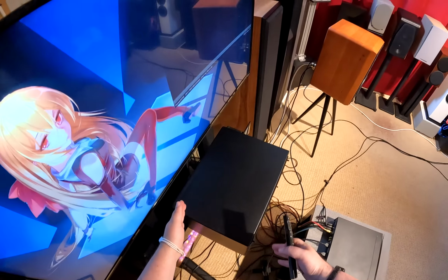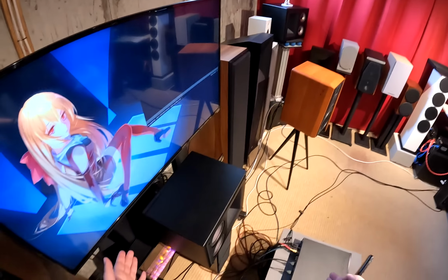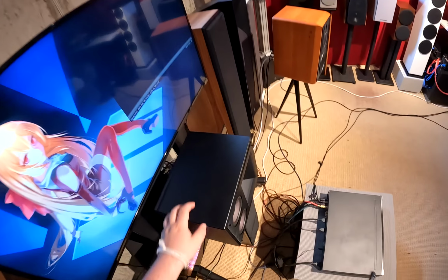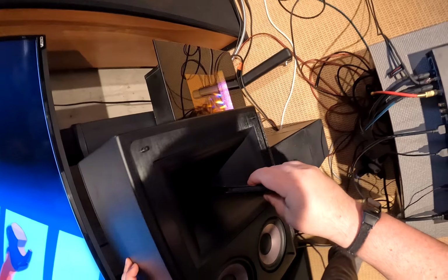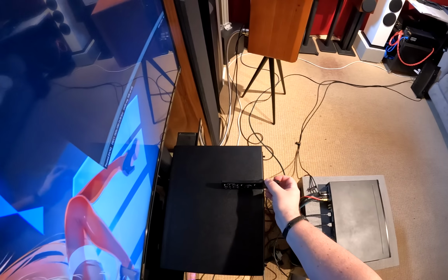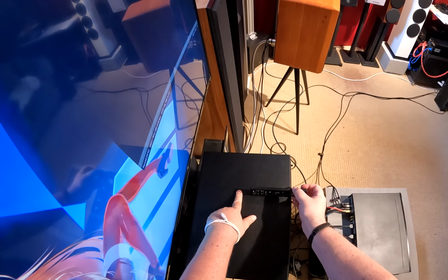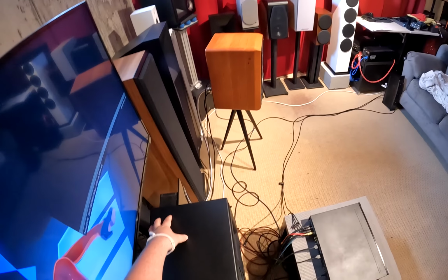This box isn't this deep because it would be fun. They didn't need it for the volume to tune the bass because there's no port, so you're not tuning bass. This box is literally this deep just to support how insanely deep that tweeter is sitting. Here, wait. And this is just hitting the front of the cone. So you hit the cone, that means the driver surface is probably here, and then you got to add the magnet structure. Holy God.